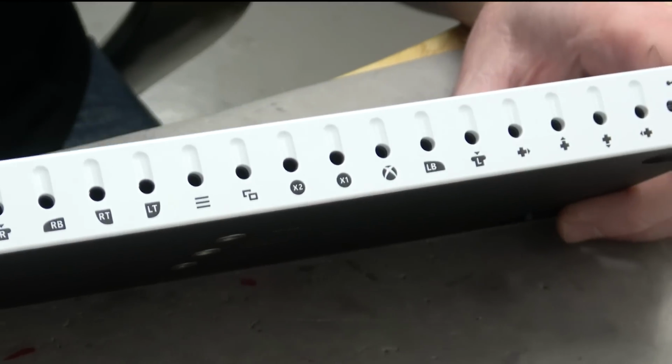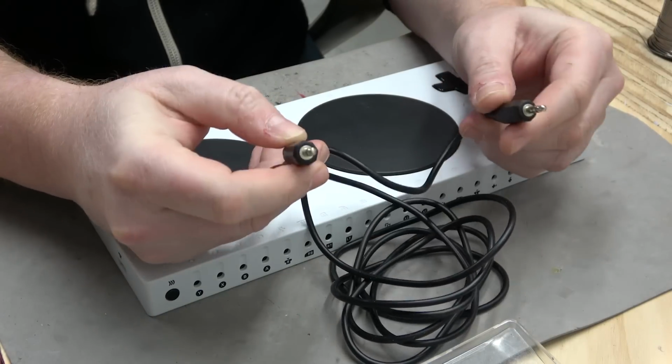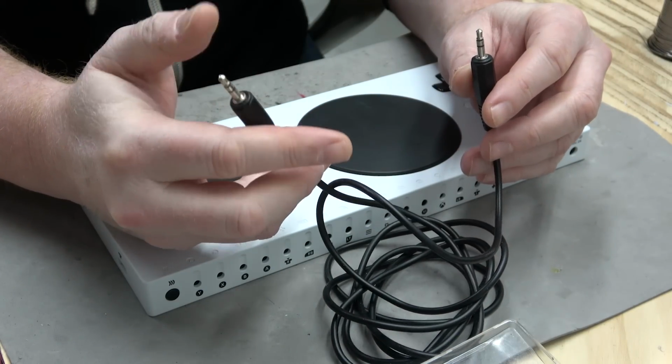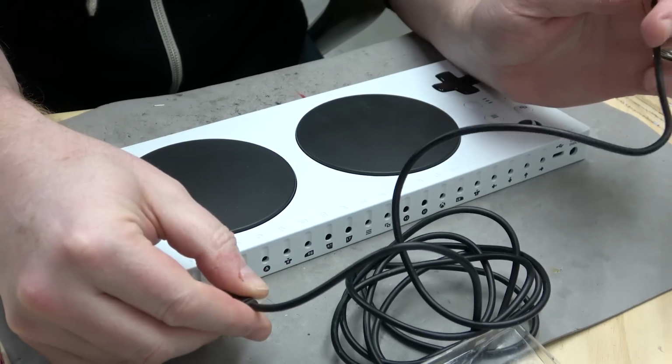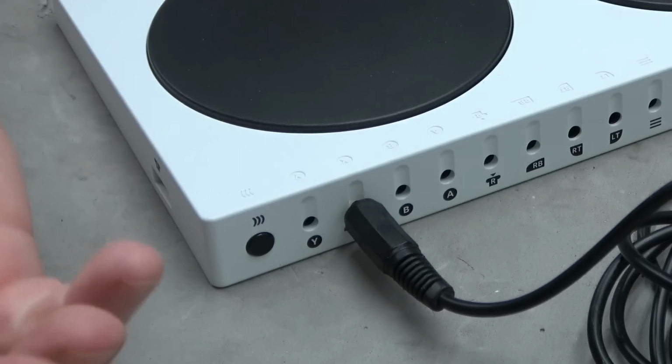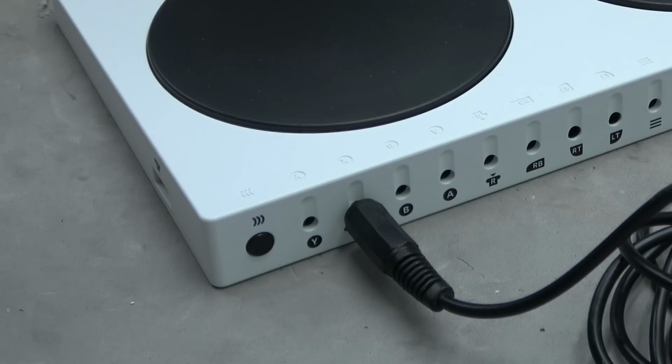So there's a bit of a standard actually when it comes to accessibility controllers. This is a stereo plug, but it would still work. So basically you have a mono 1/8 inch jack, and then you hook it up to random accessories like foot pads and things. Then you close the switch, and on this controller that will activate the button for you.